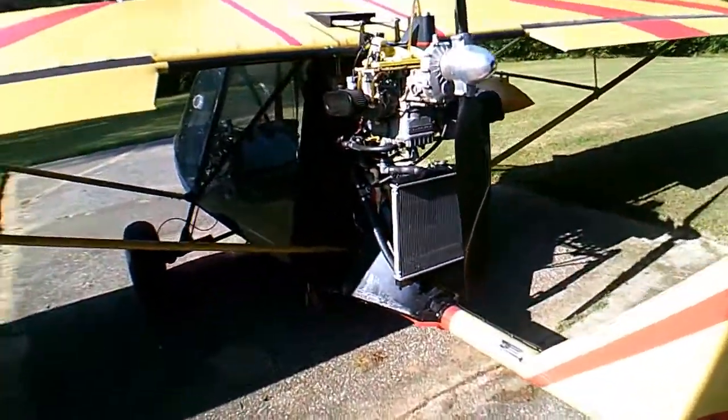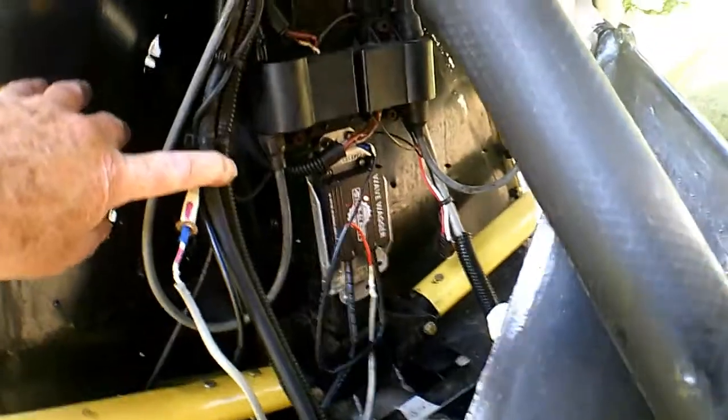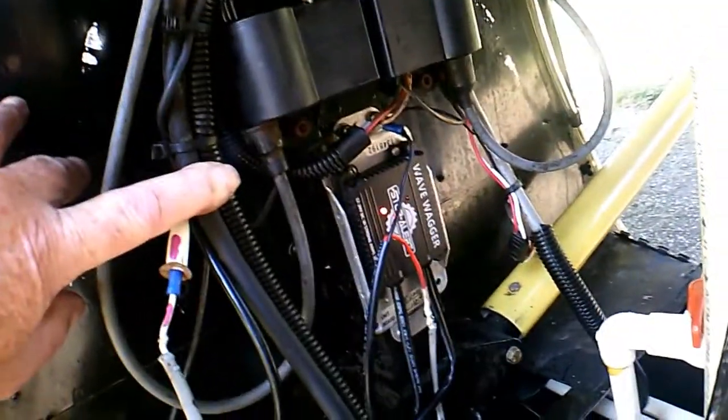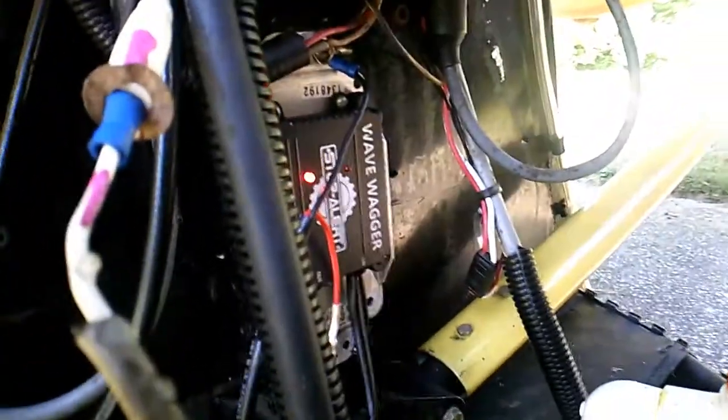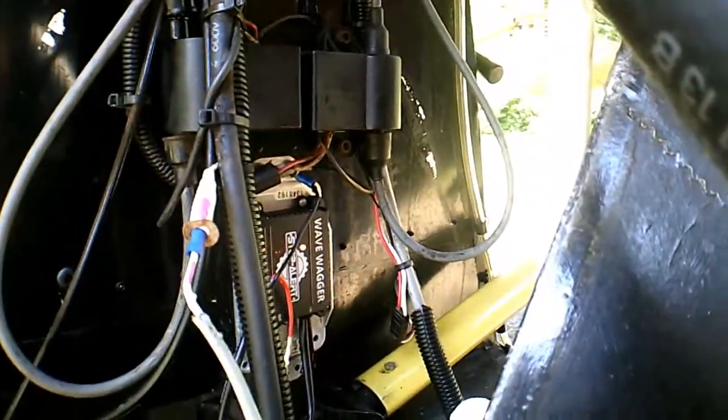It's driven by a flasher unit that's down in here. You can see those lights blinking on there — that's the flasher unit that's controlling it. By putting a switch on one wire you can change the flash pattern, and those red lights show you what the flash pattern is.